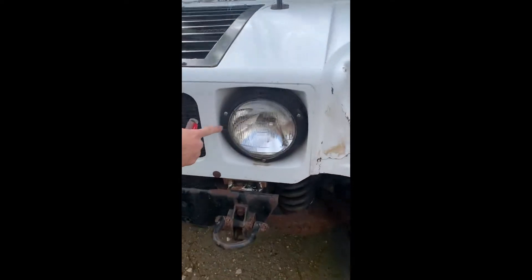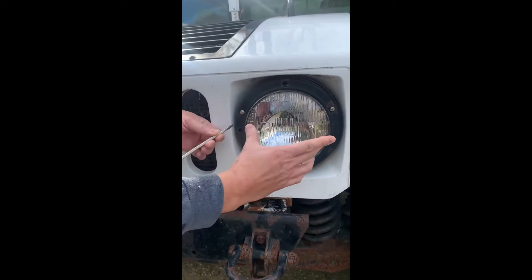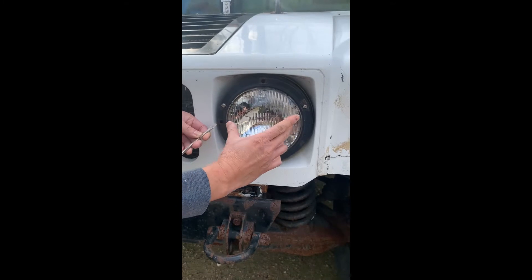The one at the top, one to the left. When you screw this one in, it will pivot the headlight inboard. You back it out, you pivot outboard.